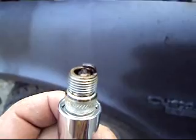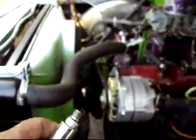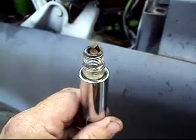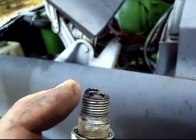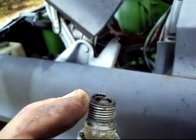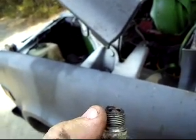It's got oil on here because the valve stem seals got dried out from the old radiator. I just replaced that radiator about two months ago, but I haven't had a chance to replace the seals yet. Here's another plug — it's semi messed up. You can see it's oily on the edges there. All that black crud is a product of oil that drips through the valve stem seals into the cylinder and then gets combusted, but it doesn't burn efficiently like gasoline. What it does is dry up and clump on the spark plugs.